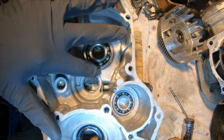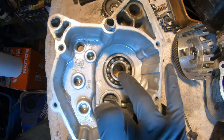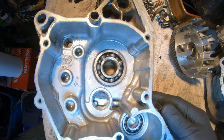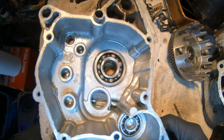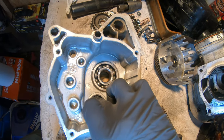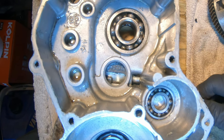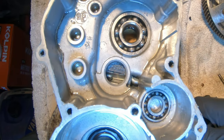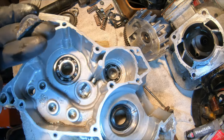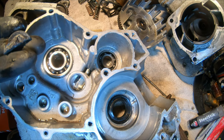All right, fast forward to next afternoon after work. There we are - I did take my tool and clean that up just a little bit. Here's the action now. Tell you what I'm bothered by, though - I see movement. I know I got some loose shards in there, but that whole thing flexes. I just put the screwdriver down in there, and it molded well, but it did not bond to the aluminum. So I'm going to have to get this aluminum cleaner and roughed up to make a better bond.